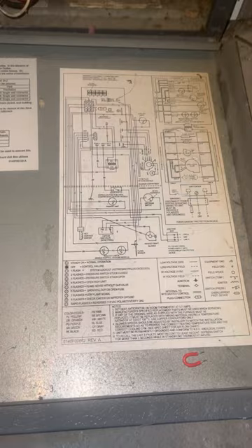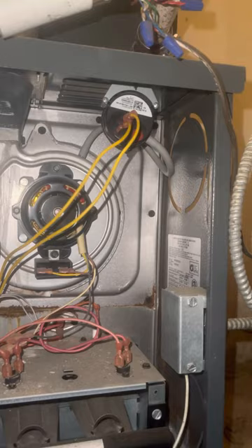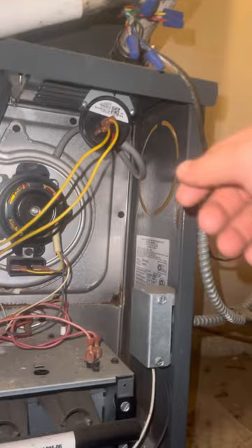The flash that I had was three flashes, which is telling me that the pressure switch is stuck open. Then I did the research — this is what the pressure switch looks like. It has a hose running to it and two wires. It's a diaphragm inside. At first I thought it was a faulty switch.